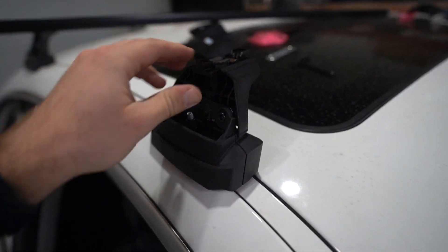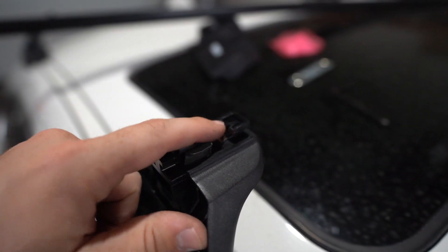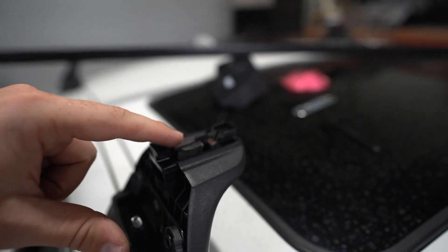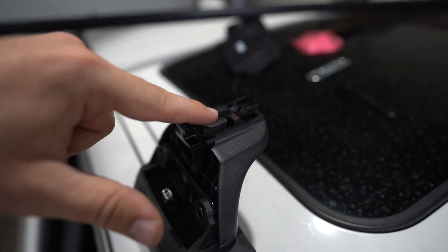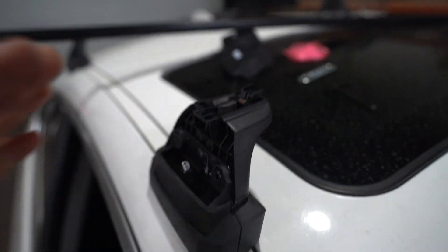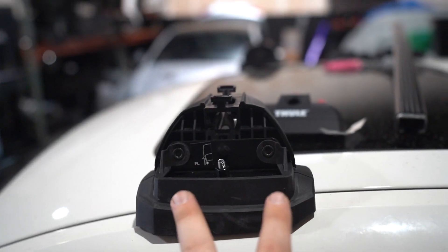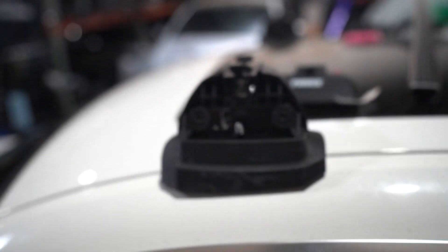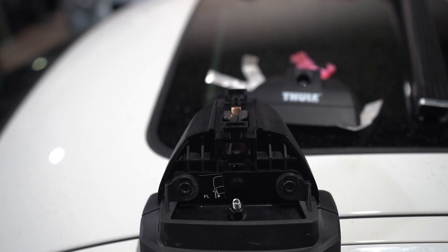So I think I figured it out. Before you put on the bar, you're going to have to loosen these two bolts. Because once you tighten it, it kind of angles downwards to lock it in place. When these two are loosened, this top part becomes more flat so that you can actually push the bar through. I can see on this other side it's angled down, so I just got to loosen these two bolts slightly so that this top part angles flat instead of down.